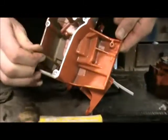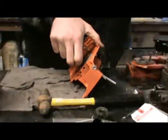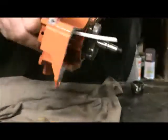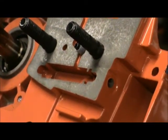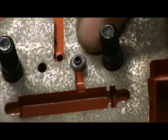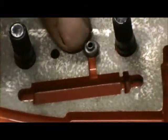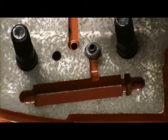That's where it's going to sit on the inside, right up in there. The new tube — which I'm going to show — comes with a completely different setup. I couldn't find anything on it online or from the dealer. After about a month, going down to the saw shop and tearing apart one of their 395 XPs, we found they replaced that steel dowel with a smaller, stubbier steel dowel pressed into a piece of plastic. Now I have this shoved into my 5.1 millimeter hole, which is the oil vent hole, with the tube facing a little bit off to this side and up.